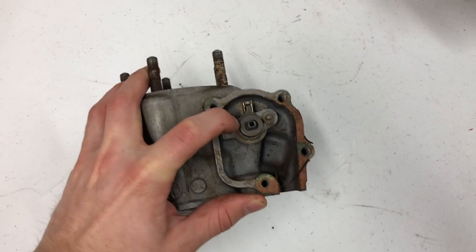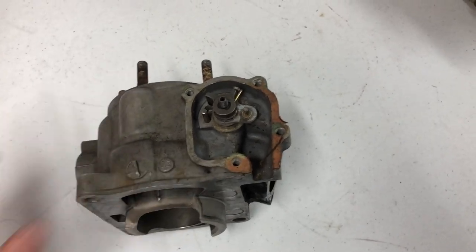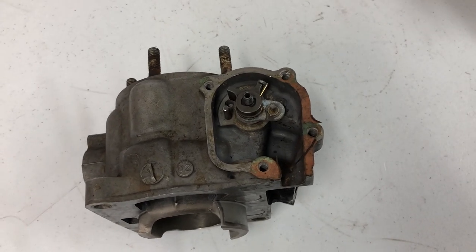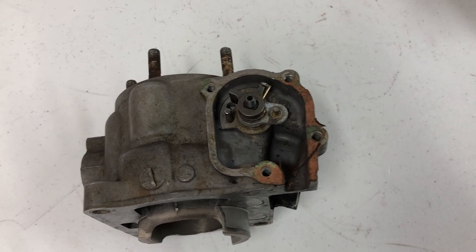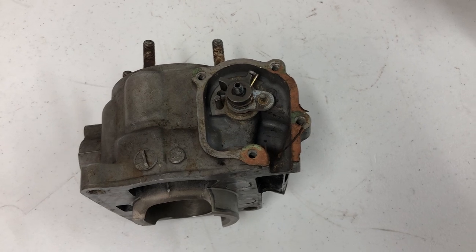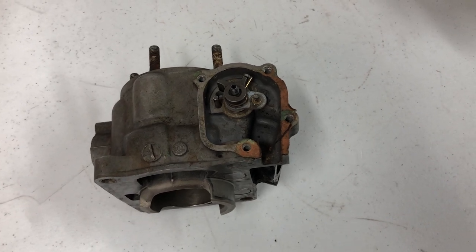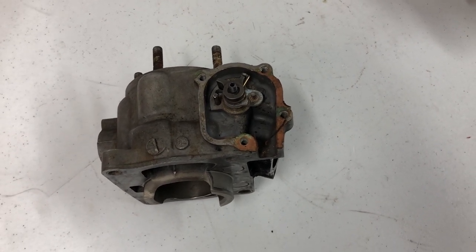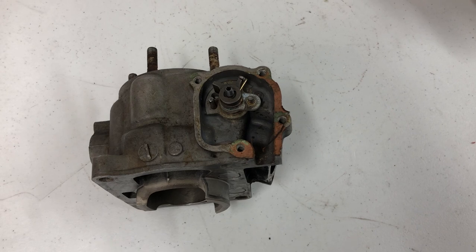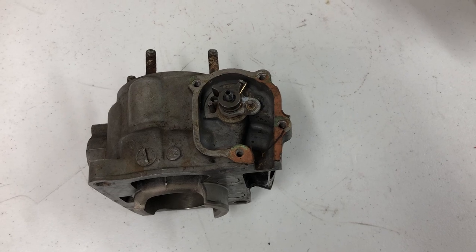The last question I'll answer in this video: do power valves need to be serviced? Yes, you do need to service your power valves at some point. The manufacturer recommends every 8 to 15 hours usually — I think that's a little excessive and you can get away with about 20 hours. But you do not want this thing getting stuck if you're racing, because it will damage your power range. If it's stuck down, you'll have no top end; if it's stuck open, you'll have no bottom end power. In the next video of this engine build series on the CR125, I'll be showing you how to clean out your power valves.